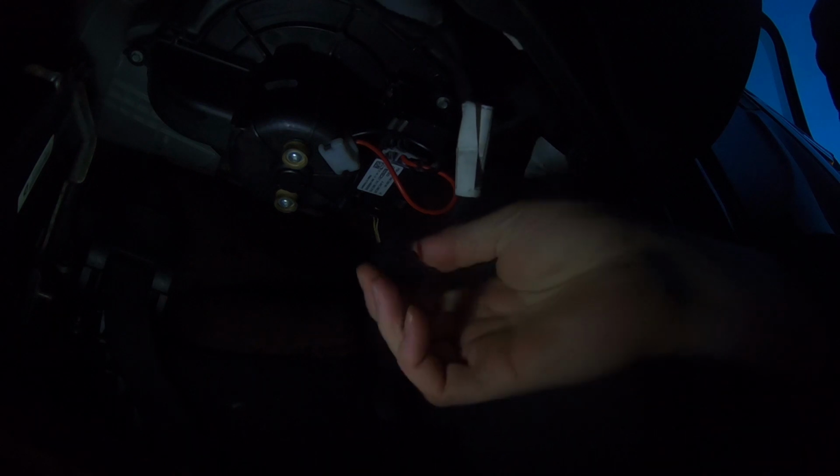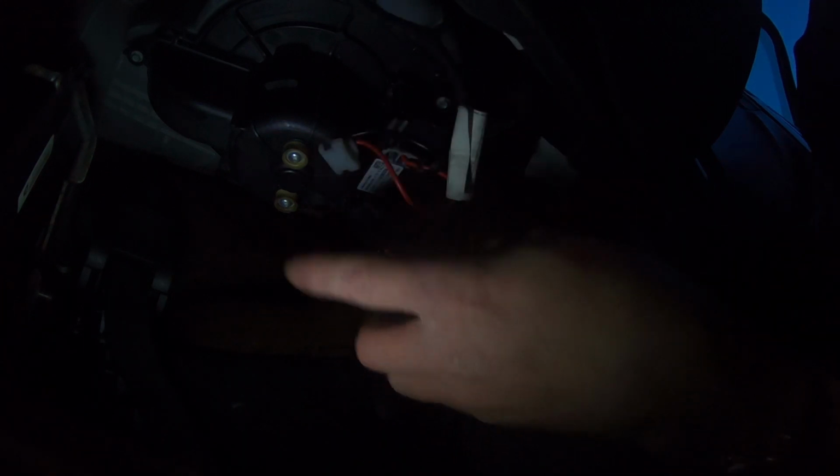So straight away I'm led to believe that this motor is the problem. There's a problem with it somewhere in there. So it's going to have to come out and we can do some more tests on the bench. So I'll turn that off. And to get this motor out, there's about 5 5.5mm bolts. There's one there, it's round there. So I've got my impact with the right size. So I'll just move you guys back, see if we can get this motor out.